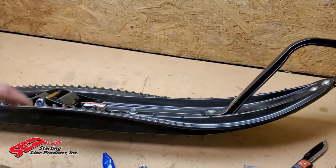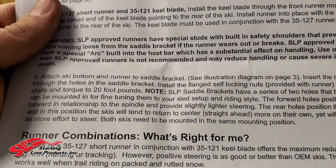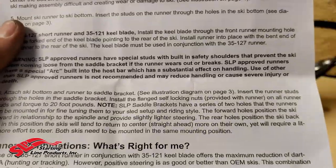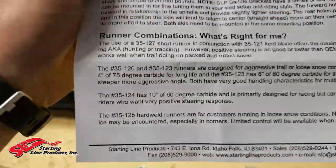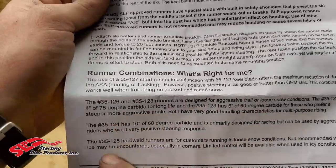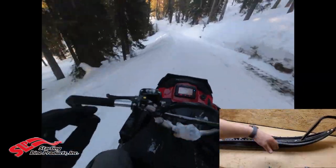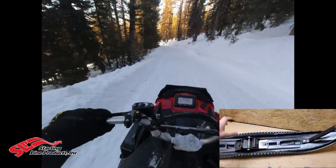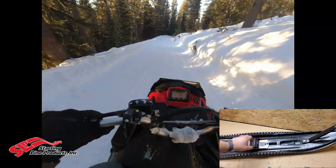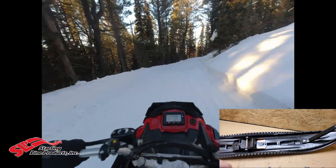As I mentioned, they're seven and three-eighths inches wide with a main ski bottom of six inches. That little extra wing on each side really provides extra flotation and bite in loose snow conditions on or off the trail. Going down the trail, these skis don't dart at all — they're perfect as long as you have them aligned. Similar to the Polaris gripper skis, they have what's called the Mohawk edge, which is why they're called the Mohawk skis.